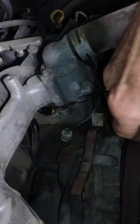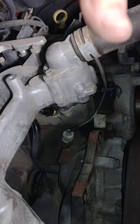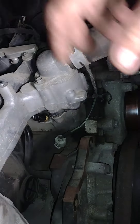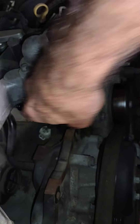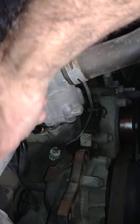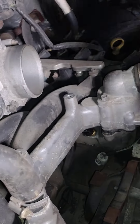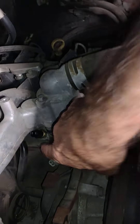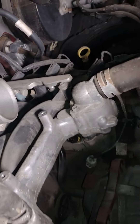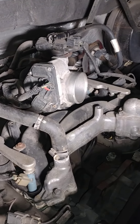So that's it. The coolant temperature sensor is underneath your alternator. You need a 19 millimeter wrench and socket. Other than removing the 10 millimeter bolts for the alternator — which I'm not going to explain — if you're changing that sensor you've already figured out how to get the alternator off these trucks. Good luck, hope that helps somebody. Peace.